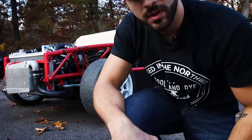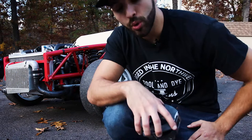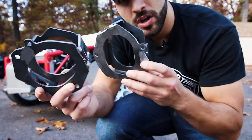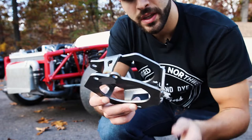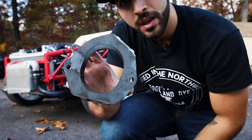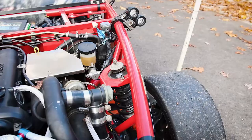My Exocet is jacked up and I'm going to start pulling the bolts for the suspension. The front spacers are left and right specific, so do not put the wrong spacer on the wrong side. Looking at the spacer, the top has two holes and the bottom has three holes. You want the two-hole side to be facing back and out. Then we're going to go ahead and remove the top nuts from these shocks — this nut is a 14 millimeter socket.